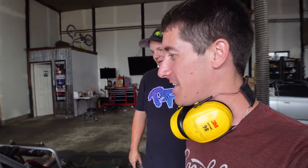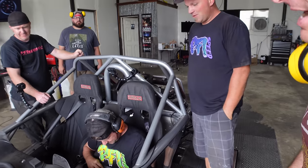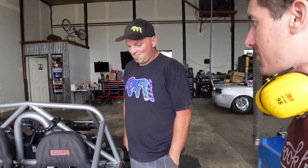It's spring. Yep. So it's got a red and a black wastegate spring in it now instead of just the red. Should be about 10. Yeah, 10 on wastegate? Yeah. And then we can turn it up from there.